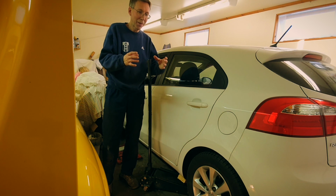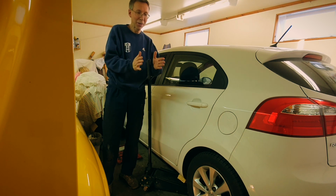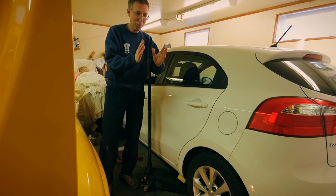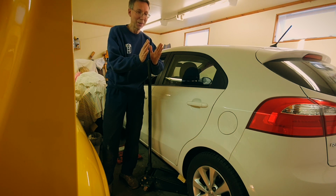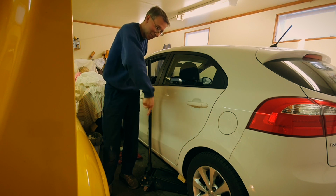And the pads get stuck in the caliper. When someone brakes lightly, there's no brake pressure added at all, so there's no heat at all, and the pads get kind of stuck and don't move when you brake lightly. Then if you brake hard, they take a new set, and they start to wear out and even overheat the pads, but after a while it's been worn off, and then it's kind of going like this.